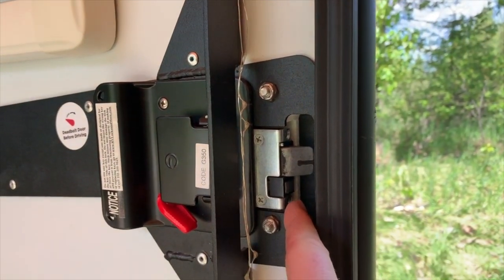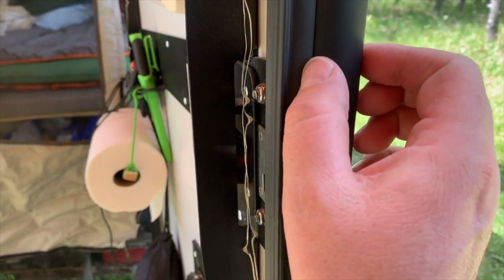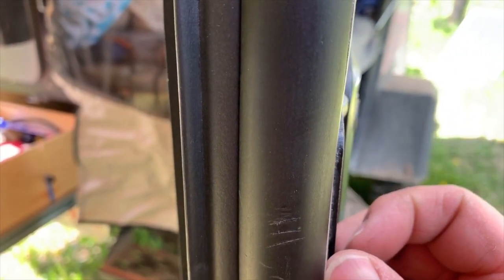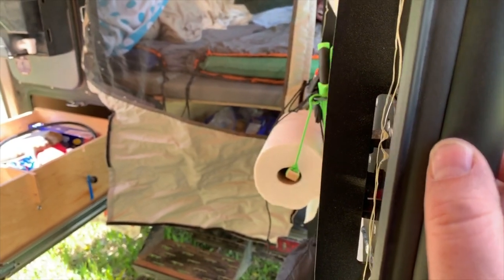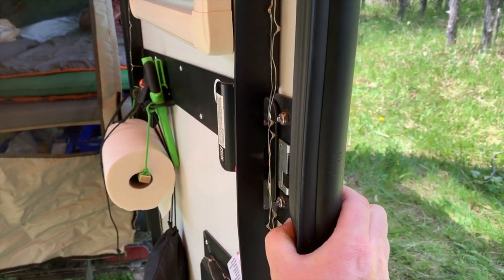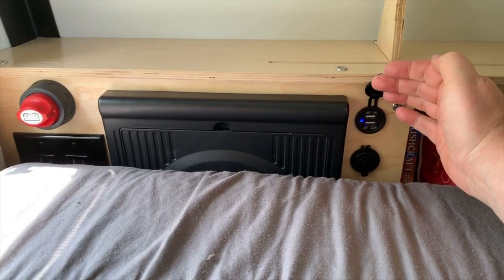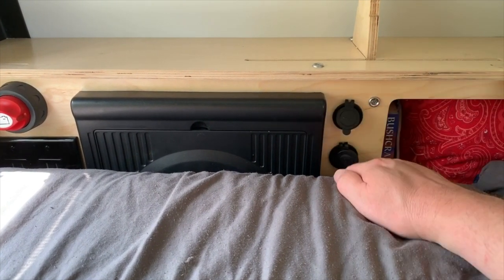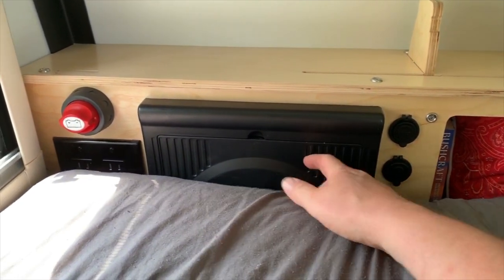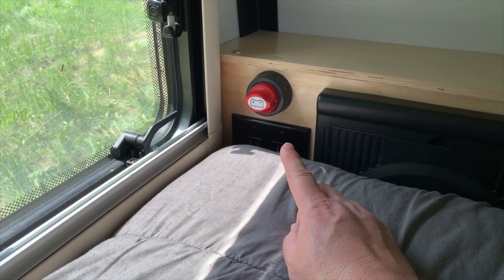You can get a look at this panel — this whole assembly is one inch. You have a thin aluminum skin, filled with foam — just styrofoam — and another aluminum skin. So if you're screwing through this panel, don't over-tighten because you will just collapse the foam. The electrical has two USB outlets, a 12-volt cigarette lighter outlet, a charge reader status display, a simple panel, and then four 120-volt regular outlets for when you're on shore power only, the way it comes wired up. There's also an electrical disconnect.